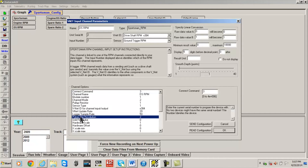This will activate a pulse per revolution input window to the right. Enter the number of magnets in your driveshaft collar, or the appropriate number of trigger pulses per revolution for your RPM sensor. With your data logger or digital dash powered up and the RacePack programming cable connected between your PC and the logger or dash, you next select the Send Configuration button.